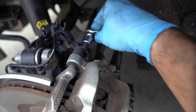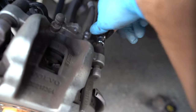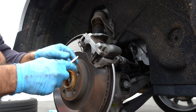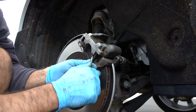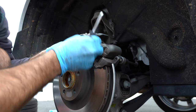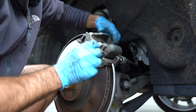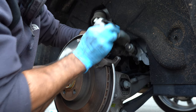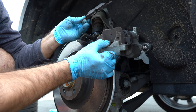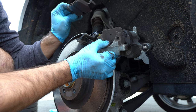Using your 9mm allen key you can get in there and start undoing the calipers. Both bolts are now loose. Next, remove the spring holding the brake pad — just take a screwdriver and yank it out. The caliper should then simply slide out. One important thing to know: the pads on the inner side have a little spring on top, whereas the ones on the outer side do not. Don't get them mixed up.